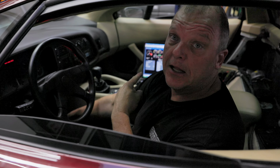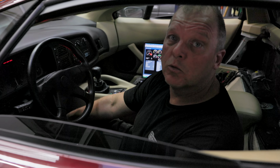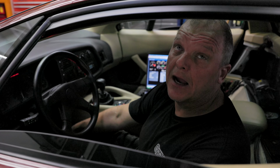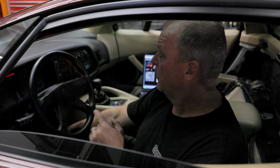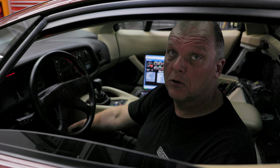So I could see there that the actual lambda compensation, once the wide bands were warmed up, seems to be about 20 or 30% negative. So at this point, I think our next step is to go ahead and kind of finish putting the car the rest of the way back together. And then we need to take this car to the dyno and actually get it tuned.